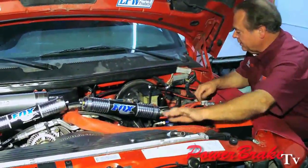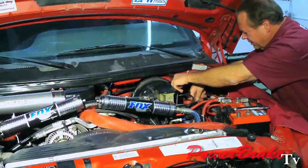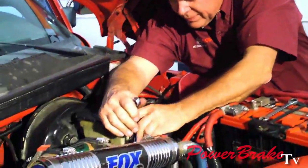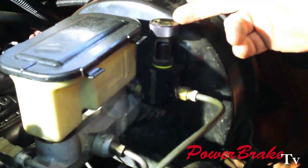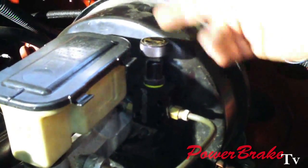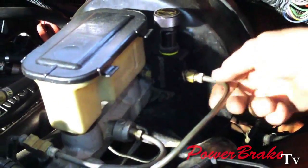With the tight clearance from the bar here, we're going to have to get this out of the way to remove the master cylinder. A lot of off-road guys remove the anti-lock brake system, which has the built-in proportioning valve. Since the ABS has been removed on this vehicle, they added an adjustable proportioning valve, which we may or may not even need. The problem with it is it does this going down the highway, which fatigues the brake line — so it really should be clamped up.